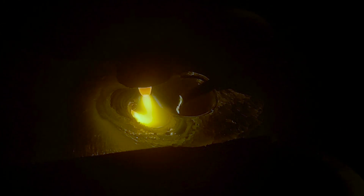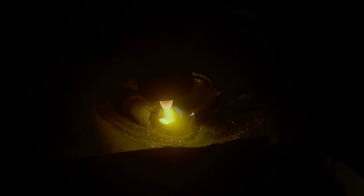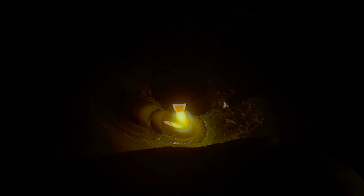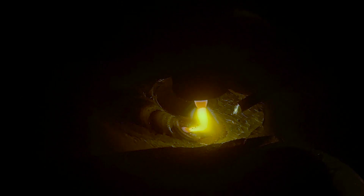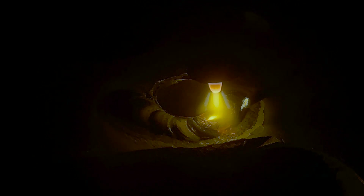The more silicon that you add into the filler rod, the cleaner it's going to weld and the harder the weld will be. And I've got my torch tilted away from that cup as best as I can. I'm just going slow. The torch angle isn't really ideal. Going back over that little speck,